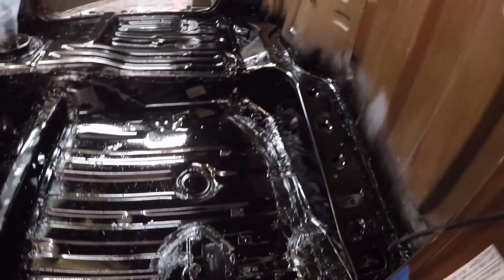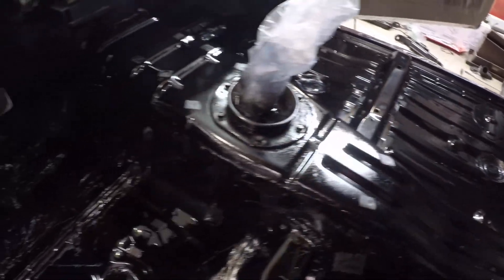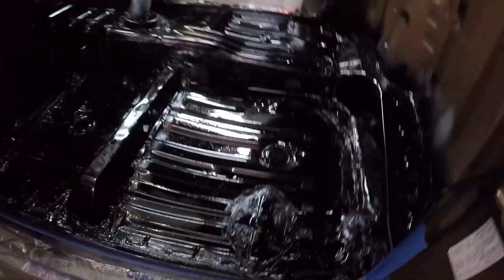We just managed to get the floor pan done - it's been sprayed with three coats and it is looking so good. I am so happy with the way this turned out. It's real crispy, so shiny. It'll probably be more of a satin finish but it might just stay this shiny. You're not going to see it since it'll get covered up by carpet, but just for you guys to know it's done - it looks great. It's got a ton of work into it: seam sealed, undercoated, Port 15, all that good stuff. It should not have any rust or moisture issues in the future.